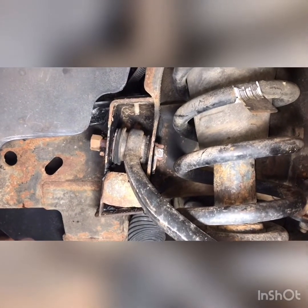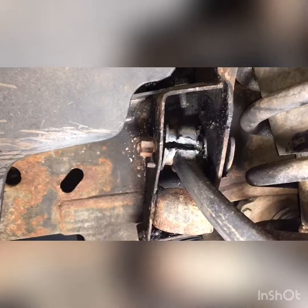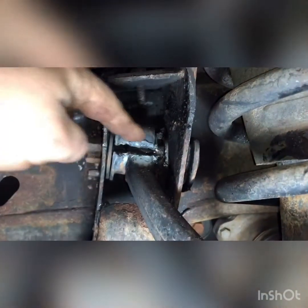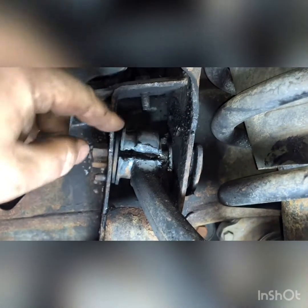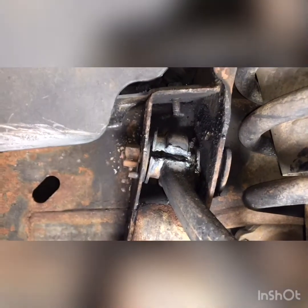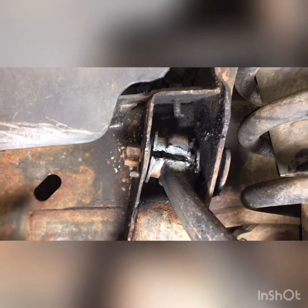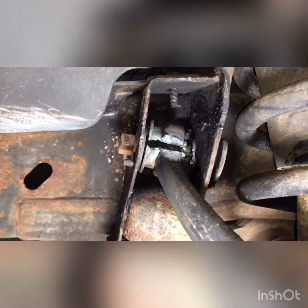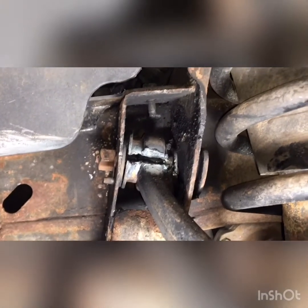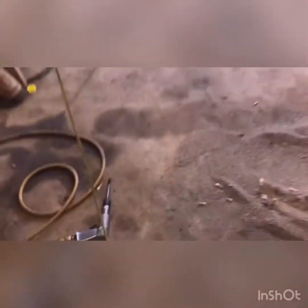This is not something you typically have to do, but you might run into. Blasted a line through that control arm. There's a little groove in the inner bushing right there. Once you blast through, you can take an air chisel and split it open, and now this bolt is free. I think the easiest way to do it is to chop off both ends of the bolt, take the whole control arm out. You could pry these open a little bit with a pry bar, but you got to have that hardware ready to go. You can get it from the parts store, but if you're good with a torch, I did that on the fly. Open it up with a chisel bit, flat chisel bit. Now our bolt is loose and we can take it out of there and then take the control arm out.